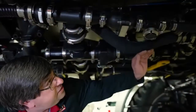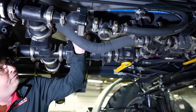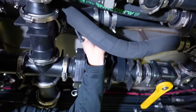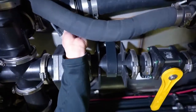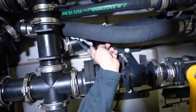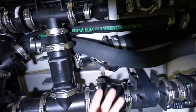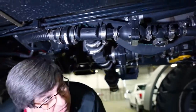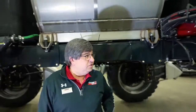The calibration number is on a fill flow meter located underneath the sprayer on the right-hand side of the tank. There is a tag on there referencing an ID number that needs to be entered into the display. Once we have that recorded into the display, that monitor is going to work in conjunction with the fill flow meter.